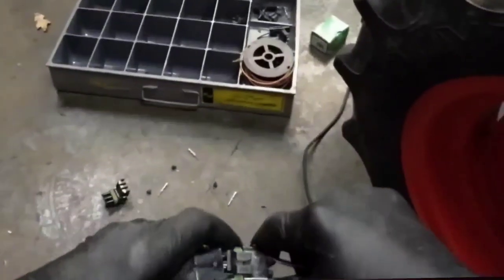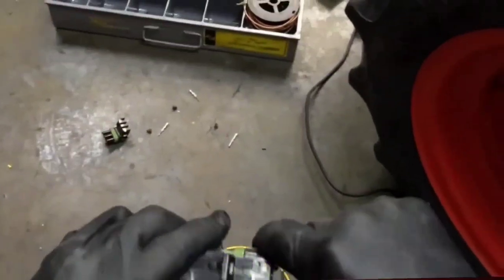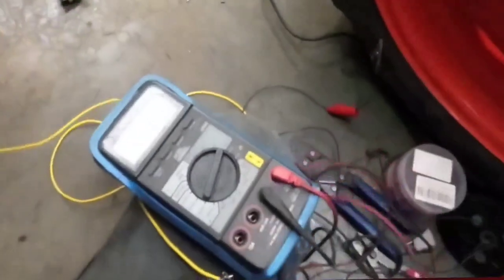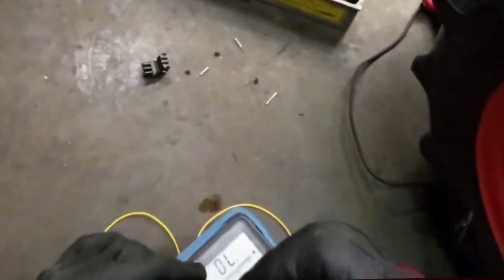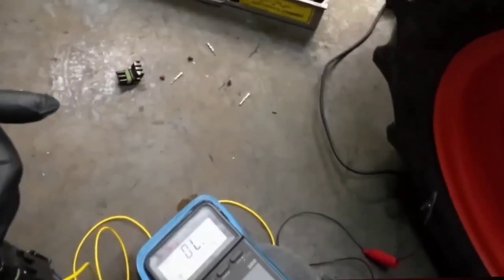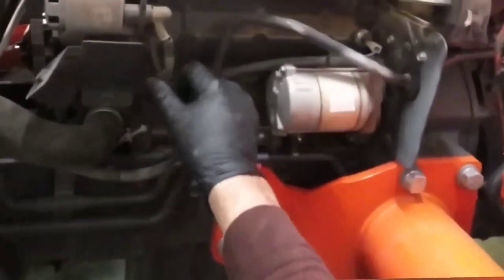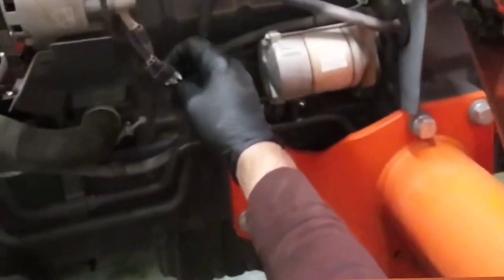You need to make sure that when you plug it in... there we go. I've got this lead hooked up to the yellow wire and here to the black wire. We've got no continuity. Let's push the clutch switch. Look at there — now once we wire around that we should be good. And then this connector for the alternator — we'll go ahead and replace that with a new connector.